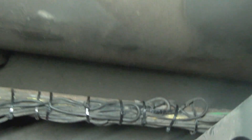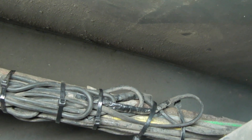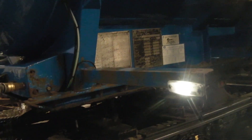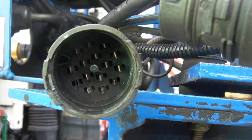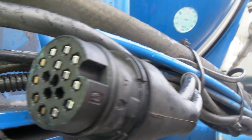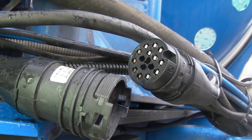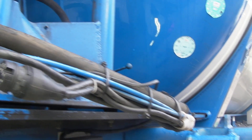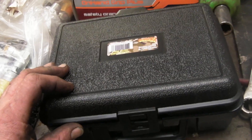When I've finished the repair, instead of using black tape I use amalgam tape - it's more waterproof and harder to get off. The side markers are now working and the vehicle can go to the MOT test. The EBS also failed due to a rotten ECU. We've had so many wiring faults because of the weather. On trailers, multi-plugs called Susie plugs take power to the lights and EBS systems, running right to the back via a 17 or 20-pin plug through to a fuse box.